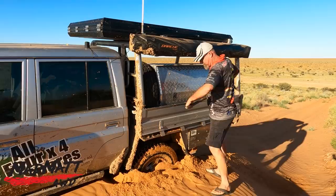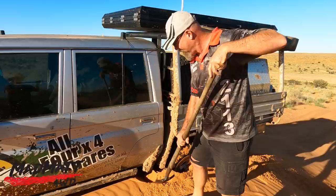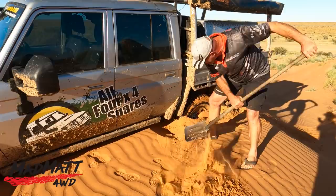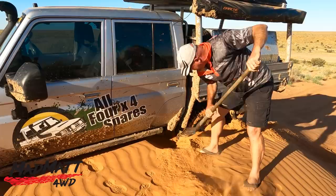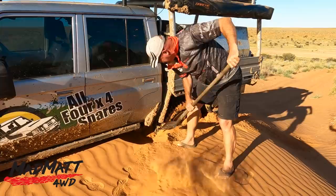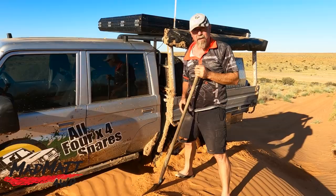The trusty shovel. Now obviously I could recover this with the winch, I could put some Max Trax in there and so on. But this video is just purely to show you the power of the simplest tool in our recovery kit. So what I'll do - dig in front of the wheels. And on this vehicle, being that it's leaf-sprung, I'll also free up the leaf springs a bit so they're not bogging in. The rear diff under the centre there will be stuck into the sand as well. The whole underbody of the vehicle is now sitting on the sand, so we'll try to free that up a bit.